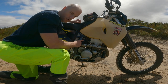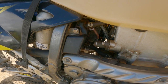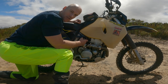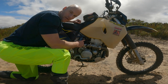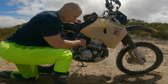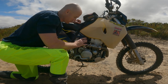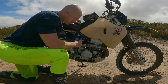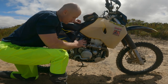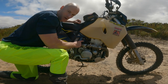Potential issue and problem number four is this little oil return box. I won't go into explaining what it does — you can research that yourself. Effectively it's two bits of plastic molded or pressed together, and it can actually crack. I've had it before — oil just starts slowly dripping down. A telltale sign is oil and grime dripping down there because dirt attracts to the oil. It's about $80 to replace, and it is a pain to get in and out, but replace the part and you'll have no problems. The oil inside can also get gummy and grimy, causing you to lose oil out of the overflow hose — another way you could potentially lose oil.